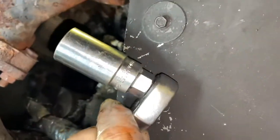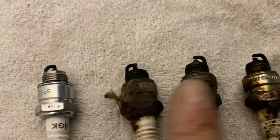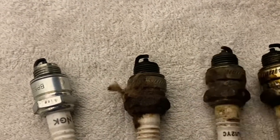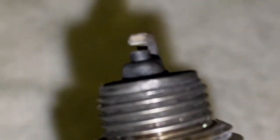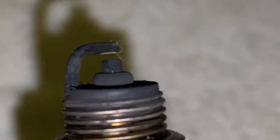I was able to just simply get that straight on to that far spark plug, which would be number seven. So there's the spark plugs in order — this will be number one, three, five, and seven. Number one I changed out and put this one on, and that's when I did a quick check of the compression. Number three, cylinder number three. This was from cylinder number five. And then finally, this was from cylinder number seven.